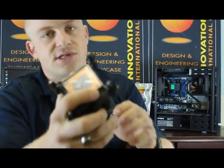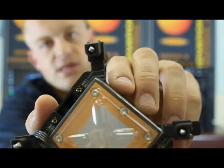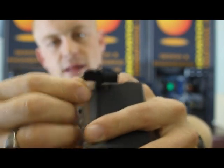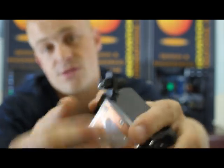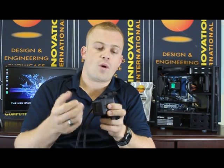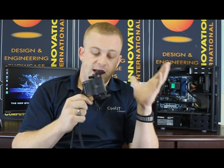We've got a really cool retention system. For Intel, it's a universal design. You can see that all three sockets are labeled. If you want to move from one to the other, just grab hold of this, slide it down and let go — you've changed position. If you want to go back to 1366, back up and that's done. Once you've chosen your socket, this is going to thread into a back plate that you put behind your motherboard. It's tool-less, so you just tighten it with your fingers, or there's a slot for a Phillips screwdriver if you prefer.